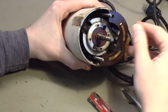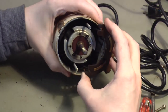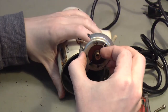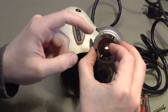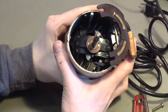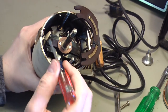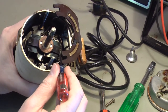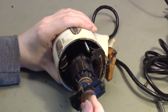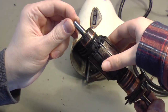This has a couple of wires attached to it as part of the speed control. There is a little bushing right there that I want to make sure we save. This cover just covers these contacts that are further inside. There's a contact right there and a contact right down here. By this point we can pull the whole rotor out — I feel that it's loose. If you look closely, you can see that there is some wiring here, but this wiring is all okay.